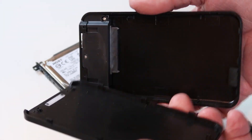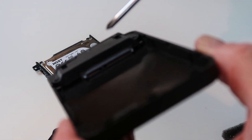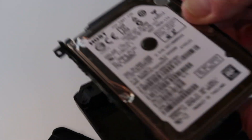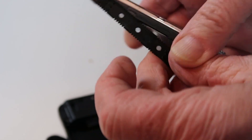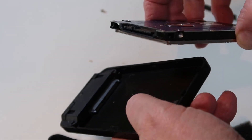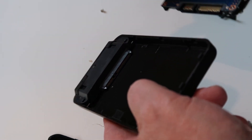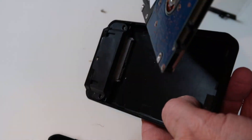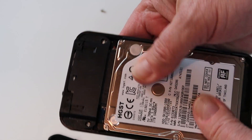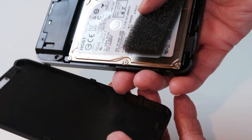It took a little encouragement — this one did just snap open. And what you'll see here is that same pin design with the long bar and the short bar. That will line up with your long bar and short bar on the hard drive. Now I've got to be careful because this has an encasement around it — I have to take that off first. That's screwed on the side, so let's take that screw off first. Now my hard drive is ready to fit in there. You see that the pins are shorter and longer, and in there are the plugs that are shorter and longer. All I have to do is make sure that the alignment is correct — the short and the long — and just slide that in place so the connection is made. Then they give a little piece of foam just to keep it from flopping around in there, and then all I have to do is snap this back in place.